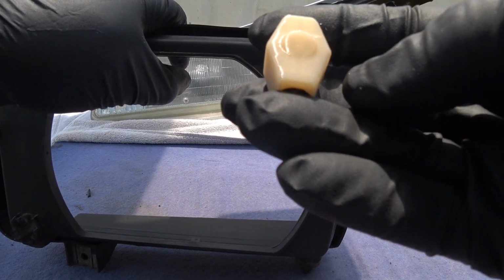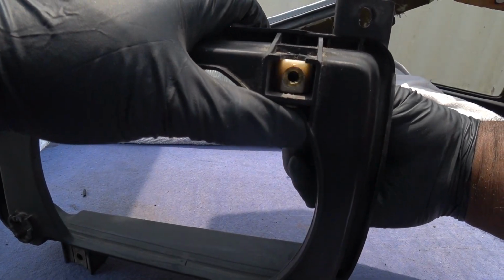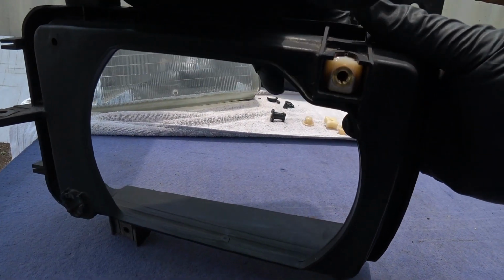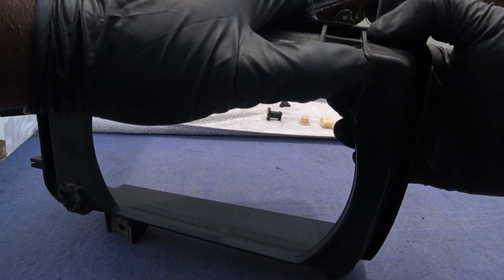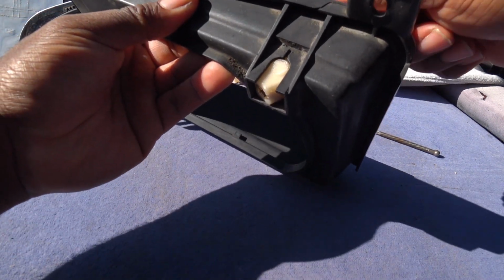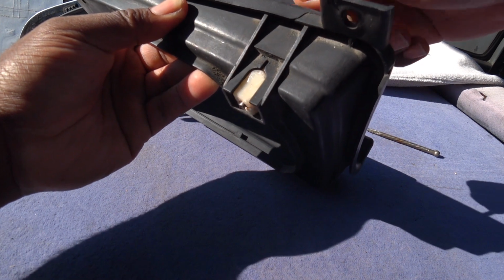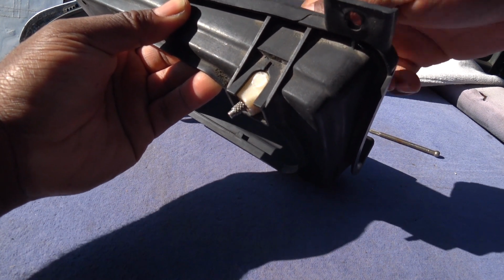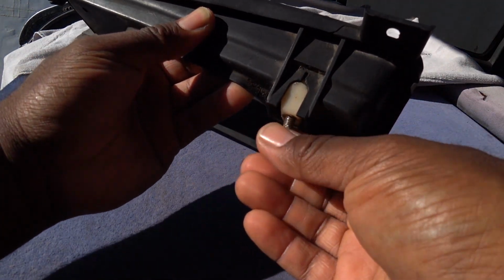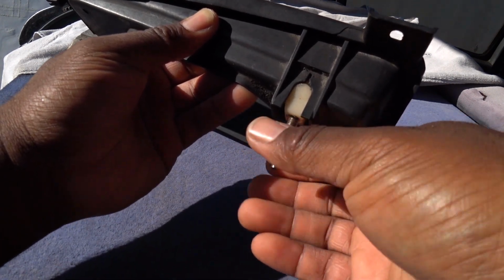Insert the adjuster from the front side of the lamp carrier. Be sure that the pivot peg with the slant is facing up or on top. Insert while applying light pressure until you feel it snap into place. Then thread the adjustment screw. Once the screw is in, install the ball cup on the balls and the adjustment knob on the knurl end. Repeat for the bottom adjuster.